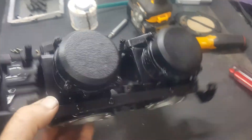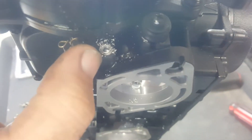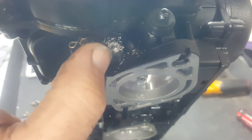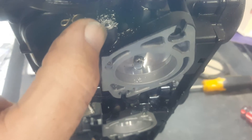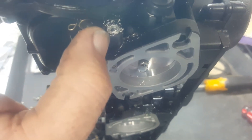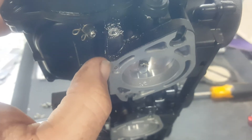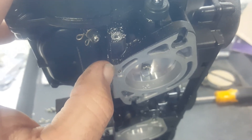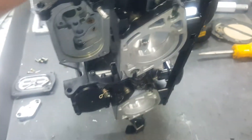What you want to do is turn these over. I've already drilled one out, but you can see right there — that is the low speed screw. They hide them on these because they're sealed; they don't want you messing with them. But unfortunately they ran these way too lean from the factory, so they just won't operate correctly after they've been used for some time.